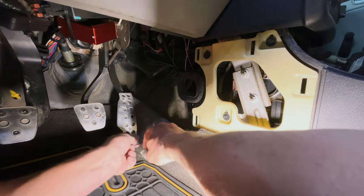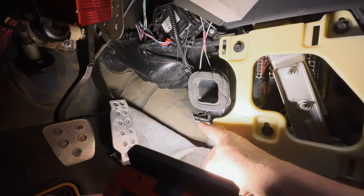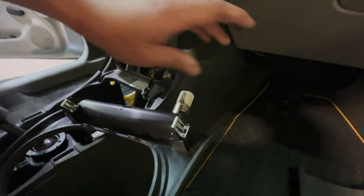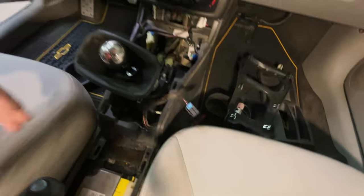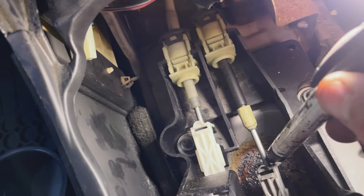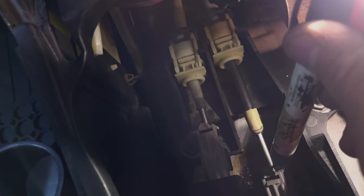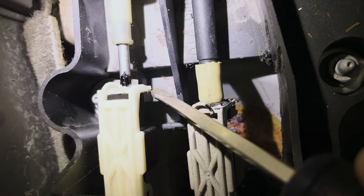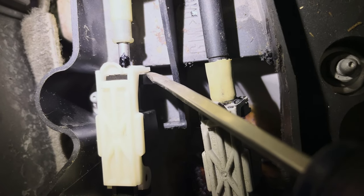That's where my grommet is — I was hoping it'd be a little more accessible. This just pushes in here — disconnected. Now before we disconnect these cables from the shifter, I'd recommend going in there and putting a witness mark as close to that as you can on both cables. Be careful with these clips because you don't get new ones with your cables.